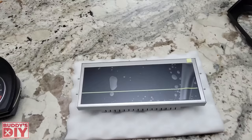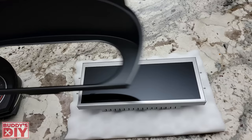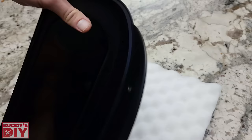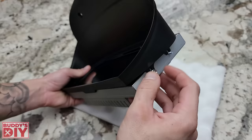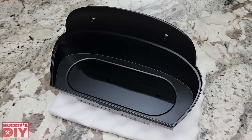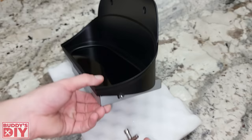The first thing I want to do is take off this little protective screen wrap and then place the cover on. The cover is held on by two little bolts here, two little bolts here, and then two bolts on this side as well. It doesn't have bolts on the bottom so you don't install it upside down. We're going to install our nuts on one side, then the other side, and then last but not least the back side. After everything is hand tightened, we press it down to make sure everything sits flush, then take a little nut driver and drive them all in.